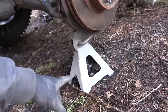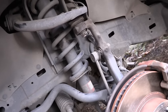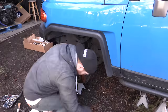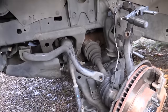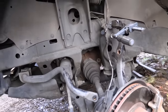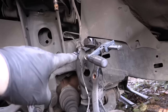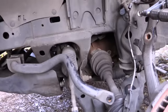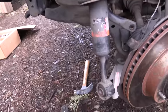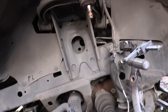That bracket is now freed up and all the top strut bolts are off. Next, put a jack stand underneath and go after the lower bolt — pull that cotter pin, remove the bolt, and hammer on it a little bit. That allows the whole knuckle unit to drop down, freeing up the strut. Take off the nut, hammer it down, and the knuckle will fall. Grab a C-clamp to hold the knuckle close to the car body so you're not pulling on any wires or brake lines.